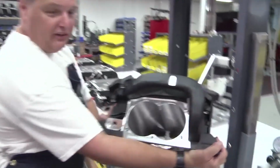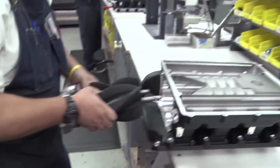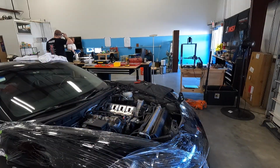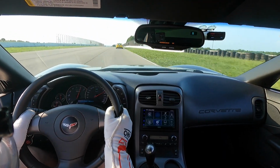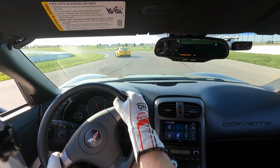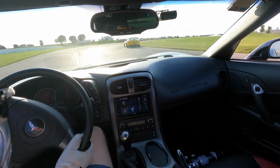Supercharging LSX. That would be a way to keep that NA feel that I like, with the instant throttle response and high torque in all situations, without needing 7 liters and $15,000 worth of motor. Right. It would allow you to basically take an LS3 or similar 6.2 and get power levels and throttle response similar to what you're getting with an LS7 platform, but without some of the costs associated there, and to potentially expand that further in the future.